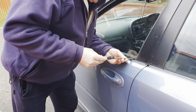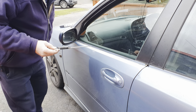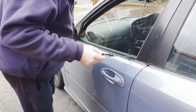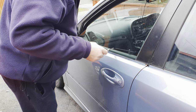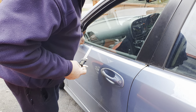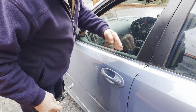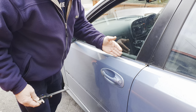If you put the window back up about halfway and then measure from the flange to the glass at various points along the length of the door, you'll probably find an inconsistent gap. I'm varying from 10 millimeters at the front to 12 millimeters at the back, and what I want to achieve is a consistent gap of about 10 millimeters all the way along.